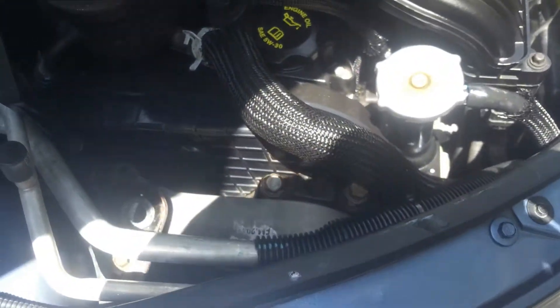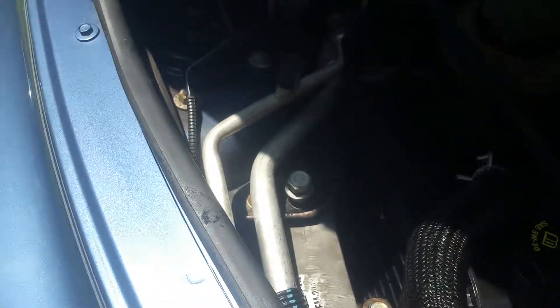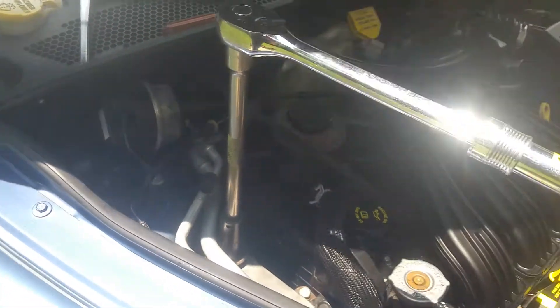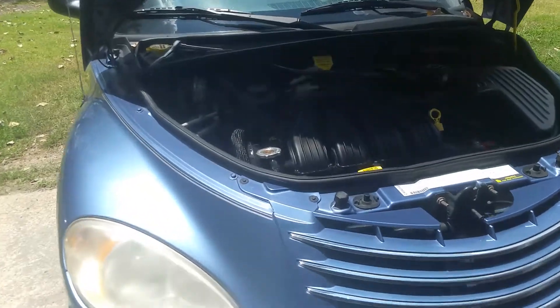So I'm putting the 15s in first and then we'll worry about the big 18 back here. Don't just tighten these yet — leave them just slightly loose. According to which way your hole needs to align, take a screwdriver in here. I had to pry it a little bit this way and now you can see that it's lined up. That's all I had to do — take the screwdriver and just pull this over just a little bit and it lined right up without even having to move the engine or anything. So it's pretty much into alignment. We're just going to work this 18 down in here and once we get it run all the way down, we'll go ahead and tighten these up. I've got my big extended handle ratchet and we're just going to snug these down really good. Get that good and tight, then we'll get over here on these 15s. So we just got those tight and down.